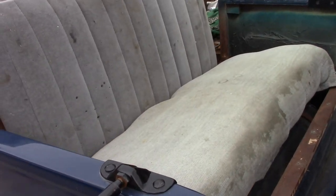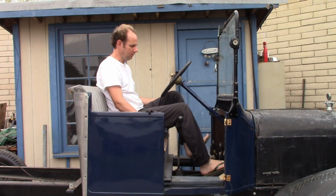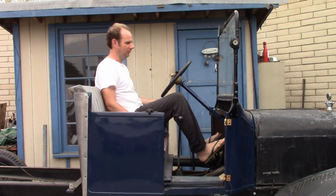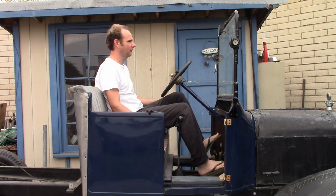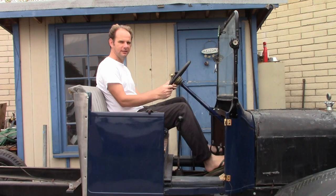And here's how it looks with the seat cushions installed. Even though we only moved the seat around a little bit, it's a massive improvement — it's a lot more comfortable to sit in. Also, even with both feet on the pedals, I can fit my knees under the steering wheel with no problem. I'm sitting a little lower than I was. Before, my eye level was about the top of the windshield. Now it's about the center of the upper frame, which is about where it should be. The steering wheel is about in the right place — I can reach it fairly easily. I don't have to reach up very high or very far. And if it's too far away, I can always move the backrest a little further forward.